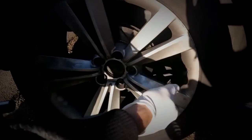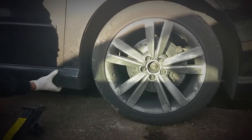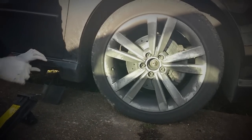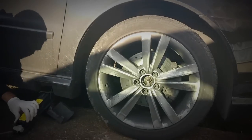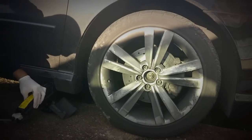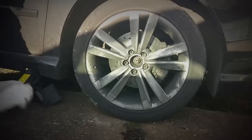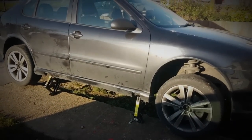Again in the star pattern, all the way across. Now that we've loosened up both tires, what I'm going to do is jack the car up. This is slightly different on different cars. Carefully start to jack up the car — it does help if you have axle stands or hydraulic lifts, but I'm just straight jacking the car up. You can see now I've got the car jacked up on both front and back axle on one side.